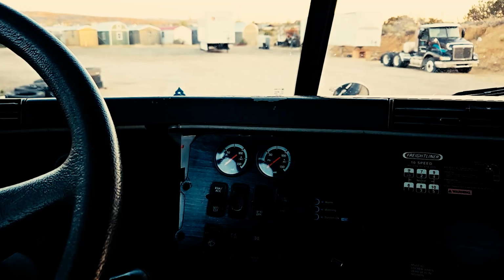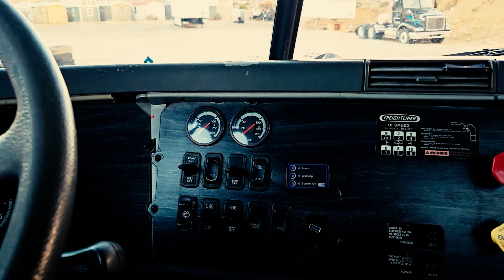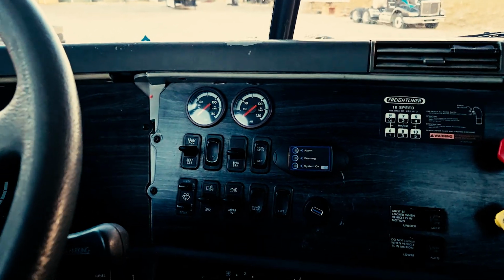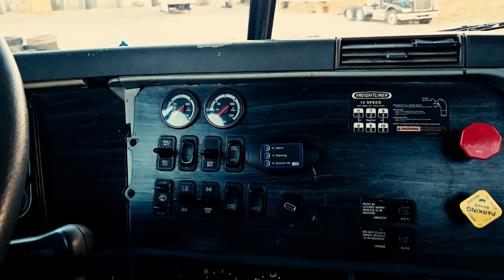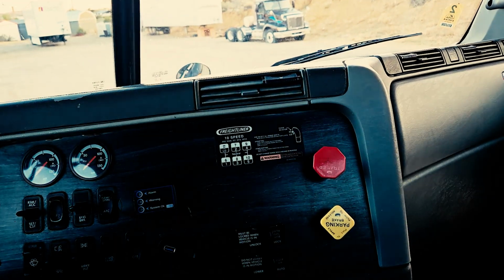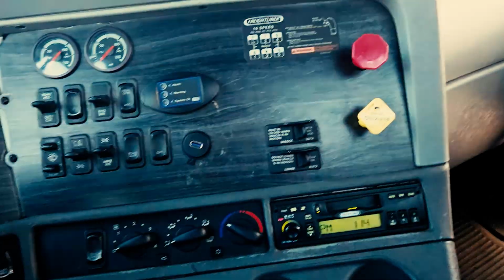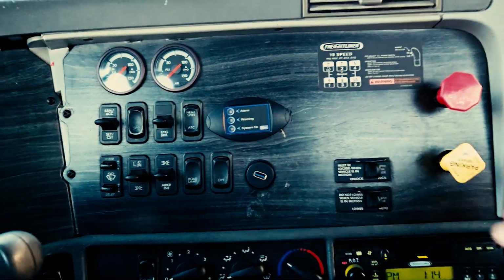Now if we move forward, obviously there would be a brake issue. So go ahead. Well, as you can see that we tugged. We did not move forward, so you tell the examiner. As you can see, my vehicle did not move forward, which would indicate my trailer's parking brakes are working properly. Now go ahead and set your brakes.